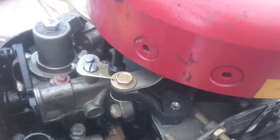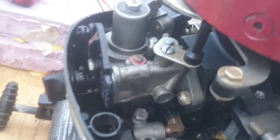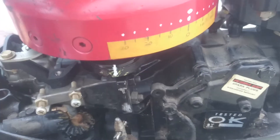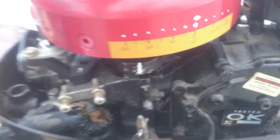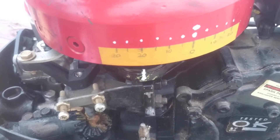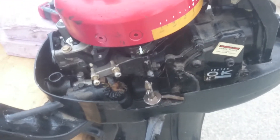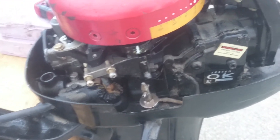A lot of people say when the carburetor is at about a third of its travel — which in my case would be around there — is to have all the ignition in. Well, mine is at just under 20 degrees. So I'll play around with some numbers and just see how she performs.